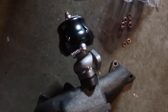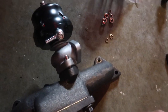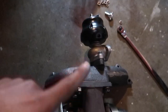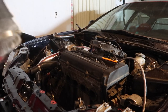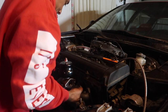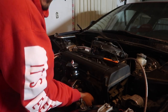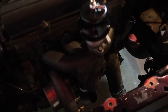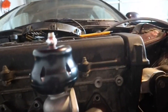We've got the wastegate mounted right now. We put the dump tube facing this way because it's going to be easier to come into the downpipe. We're probably going to drill a hole in here and have the downpipe come into the exhaust. Now we get to mount the turbo onto the head. You can see what this thing actually looks like — hopefully this thing clears the hood. That's almost flush right there.